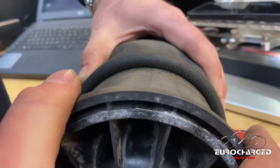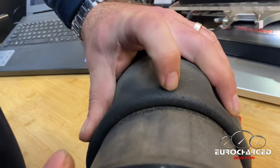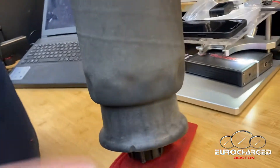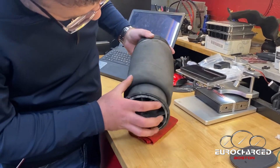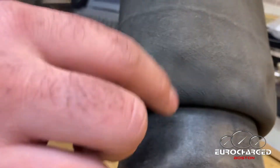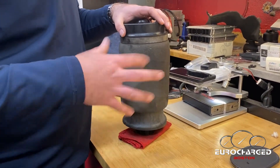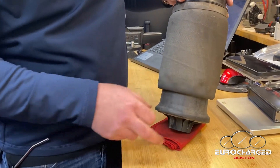Let me turn it so you can find exactly where there's cutting. You can see it right here — this is the wear on the rubber material. Eventually this starts to rip and leak air. The side effect is it starts out as the car sinking to the ground within a couple of hours after parking it, and it gets faster and faster as the leak gets worse.